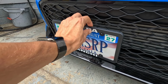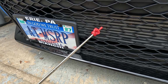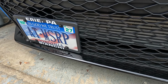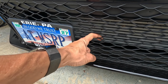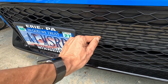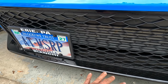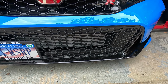in position very well. Now, if you guys want to go ahead and take that route of getting fender washers and a nut and bolt holding the frame in position, you're more welcome to do so. But just go ahead and take some precaution because holding those fender washers and that nut in position while you grab that screw, it's gonna be tough. Those things can actually fall down right inside the bumper opening. And there's basically no access unless you drop down the pan or pull the whole bumper assembly off, which, you know, that's a pain in the butt.